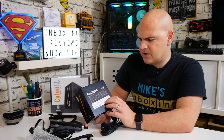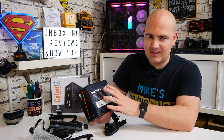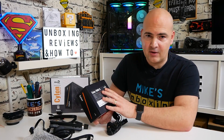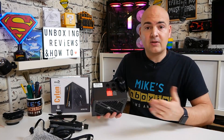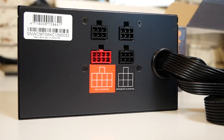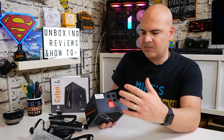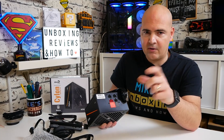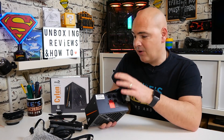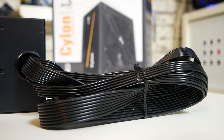The 3.3V and 5V rails at 20A each give around 100W combined, and then the 12V rail gives 636W — which bizarrely adds up to 700W. They should definitely think about hiring a new mathematician. Like I said, I would not rate this as a 700W unit; realistically consider it a decent 550 to 600W power supply — 700W is very misleading in my personal opinion. On the back of the unit you've got connections for supplementary devices such as SATA and Molex, and a single red connector for PCIe.